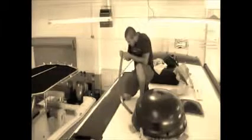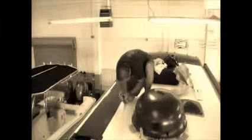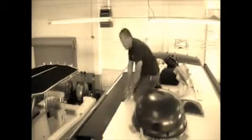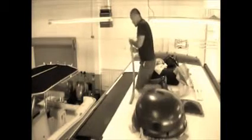Now that we have the end caps on, it's time to put the rest of the sides down. Pull the plastic covering off the micro sealant and start with the end butting up against the end cap first, putting pressure all the way down and making sure the edges line up nicely. Do the same on the other side — start on the other end cap so that if there's any slight gap, it ends up in the center. With the roof being subject to hot and cold temperatures, a small gap is okay; we want the rubber to be able to expand and contract, and allow water to flow out, even though we do have water channels built into the side rails.